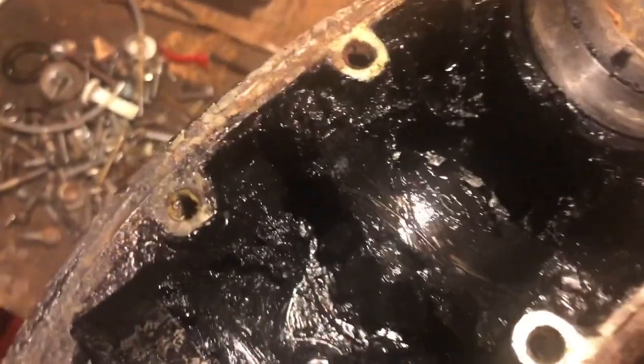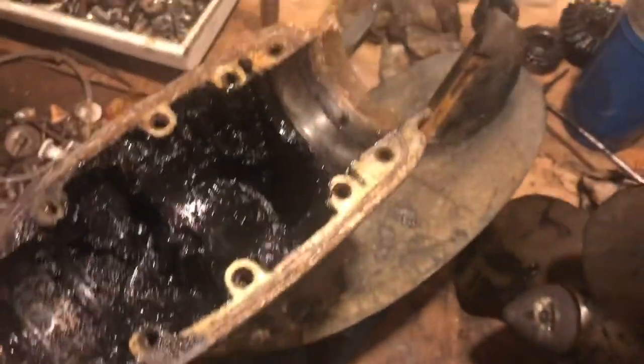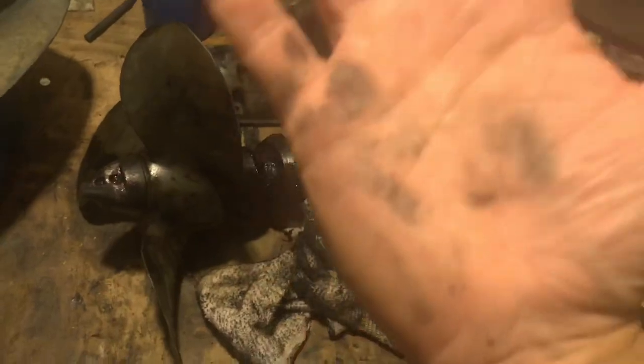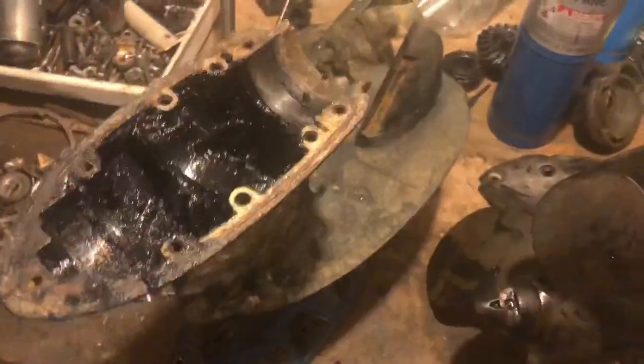Hopefully the gears are in good shape — they're just packed with grease because why mess with gear oil when you can just pack it with grease? Nine times out of ten everything stays okay, it's just not the way it's supposed to be done. So we'll take everything apart, clean it up, and then see about paint. The lower unit's coming apart very soon. I cannot wait to clean all this up — it is ruining my workstation. All my rags are messed, all my gloves are messed. This grease is getting on everything.